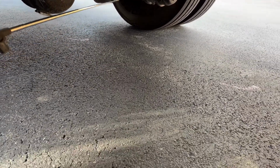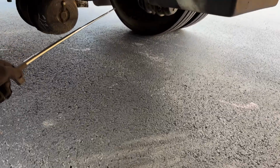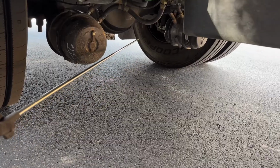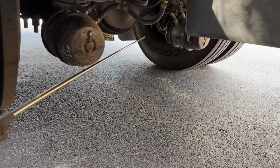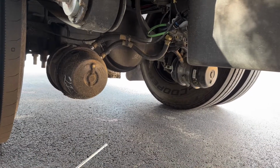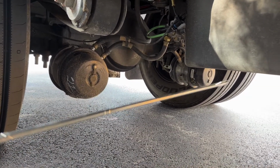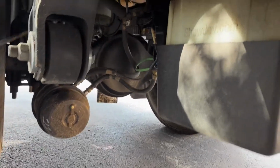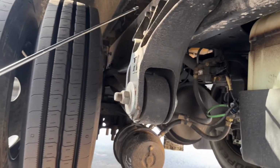We have our brake linings and our brake drums. If you look across, you can see the brake linings. And if we were to go beyond the brake linings, we would see the brake drums. They have no grease, oil, holes, dents, or debris. We also have our torsion bar back here. It's very difficult to see, but it's up to here. Not cracked or broken, loose or missing. Appears to be functioning normally.